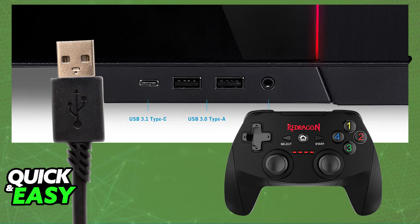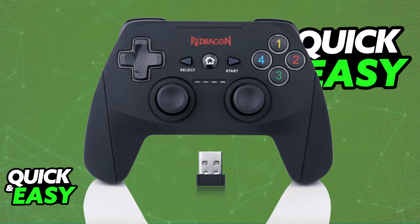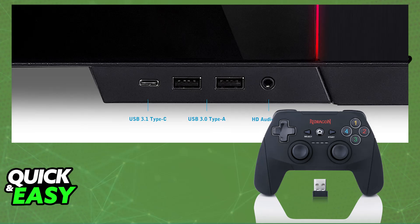For wireless controllers, you have two types of connections — you either have a wireless receiver provided with the controller, or you have to connect it through Bluetooth. If your Red Dragon model came with a USB wireless receiver, also known as a dongle, all that you have to do is plug it into any USB port on your PC. Usually, all that you have to do is power on the controller with a specific toggle or button and it should automatically pair itself up with the dongle. As long as the dongle was properly connected to any suitable USB power source, the controller will be picked up and you will be able to use it completely wirelessly.